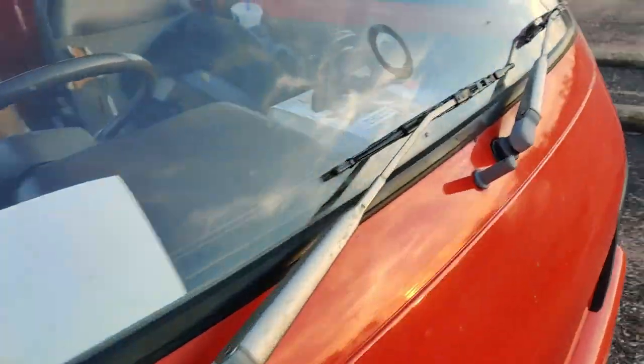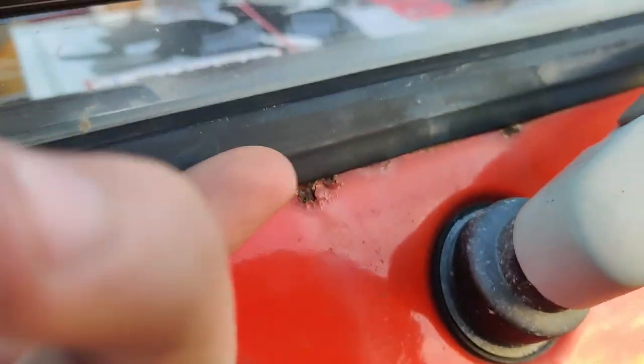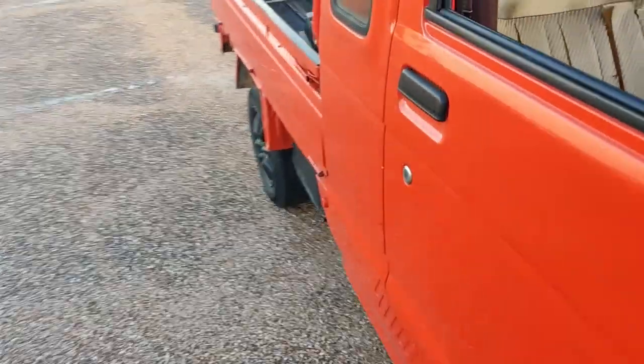There is some Toyota 90s rust, which is why I had the bed off doing rust treatment on the frame and coating it in black. I still want to do a rubberized coating for sound and for looks. Up front there's a little bit of corrosion under the seal, so I'm going to paint that whole bottom bit black.